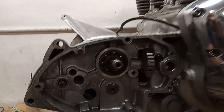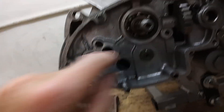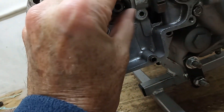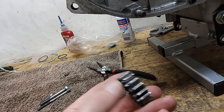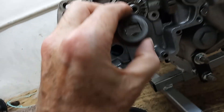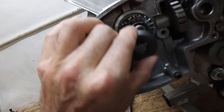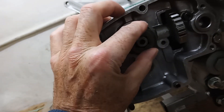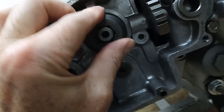I'm fairly happy so I've put it back in neutral, and now I'm going to put the kickstart gear back on. So there's a spacer up against the bearing, then a sleeve, then a sort of large Thackeray washer, and then the kickstart ratchet. The teeth can break on these so I need to check that - although I'm not quite sure what the situation is concerning new ones at the moment. This will go on the outer pull but it's got to line up with the splines, and I can't do it one-handed.